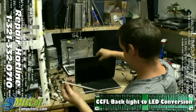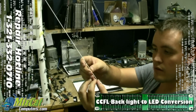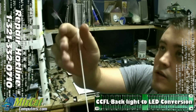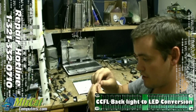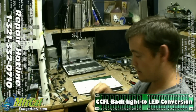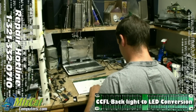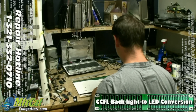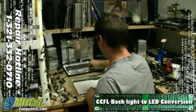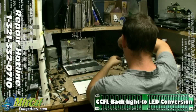Here is the old bulb, and you can see on the end where the bulb is starting to turn black on the inside — that means they're going bad. Probably because the screen's been running non-stop for about three years straight. It doesn't really ever get shut down. Just like a regular fluorescent bulb, you'll get those rings at the end when they're starting to go — they build up enough resistance at the end, they carbonize, and then they die. Sometimes you get a red hue — you see a red hue, you know that bulb's going bad.